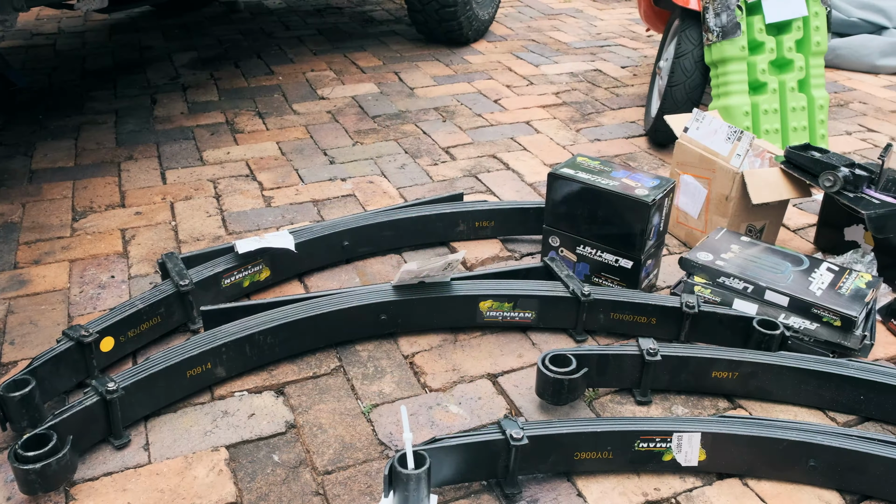This is the situation in the world right now. We can't really go traveling or anything like that. And it's allowed us to spend a lot more time fixing things on the car that we probably wouldn't have on any normal occasion. So all of the suspension components that we took apart on the car, we've taken all of the loose rust off, we've treated it with a rust converter, and then we've hit it with POR15, so that when we put all this together, we're going to get the longest life possible out of all this stuff that we bought. I don't know whether I would have done this if we didn't have all the time in the world, but I really strongly recommend it.